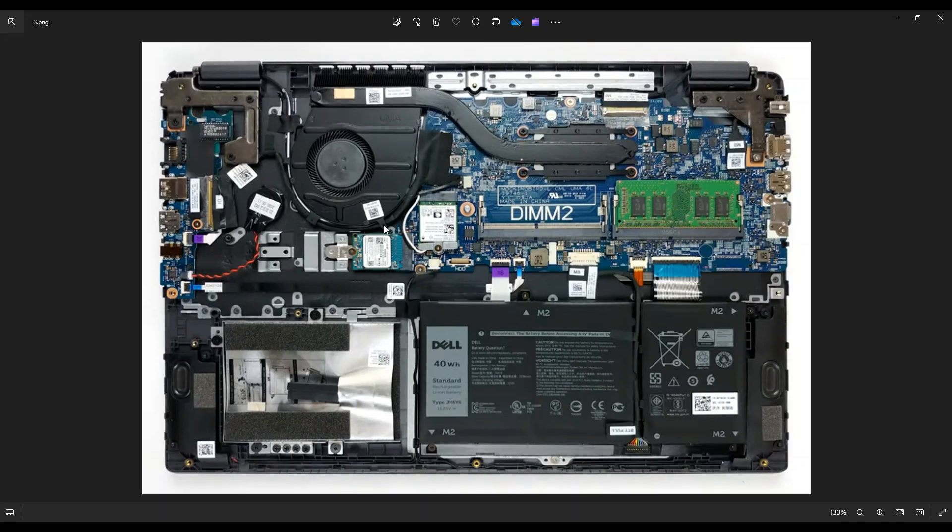Right here in the center is your Wi-Fi card. Just like the M.2 port for the solid state drive, there's a single screw that holds it down. Remove that screw, the metal bar comes out, and you can pull the Wi-Fi card out of the port. All that remains connected are the white and black antenna wires — those are just snaps, so they snap straight up and off. To snap them back on, they need to be at an exact 90-degree angle; if you push too hard at the wrong angle you can damage them, so go slow. I'll have a Wi-Fi card replacement option in the description, and also a tutorial on how to troubleshoot if your Wi-Fi isn't working — in case a replacement doesn't fix it.